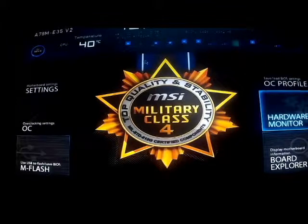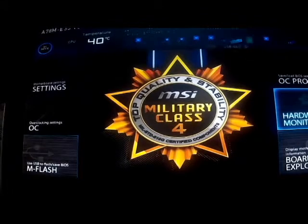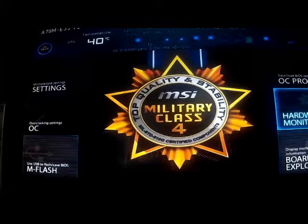Pretty cool. And once you're logged in here, like I said, this is drag and drop. The hard drive has been installed, but it's blank. And now we're ready to load up our Windows whatever. In my case, it was Windows 7 64-bit. So what I would do at this point is insert my disk, close it, and then go right here to this bar, and drag my DVD player to the primary position and drop it. That now is the #1 priority for booting when it's in that position.